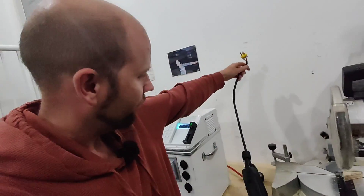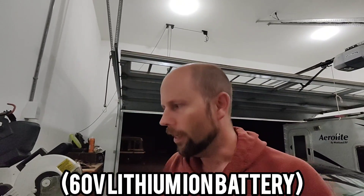So now the question is: how many kilometers did we add and what sort of percentage did we add? The battery pack does have a little bit more power — it's at 49 volts now — but you really don't want to drain these that far down that often. 48 volts is the safe lower limit. The battery management system is still showing a couple of percentage points, about 3 or 4% remaining. I'll let it cool down, then let it charge back up, but let's see what the car is at.